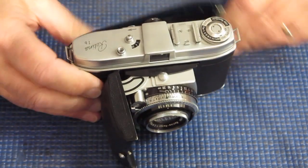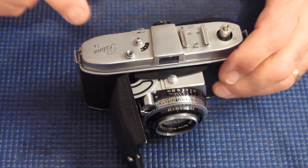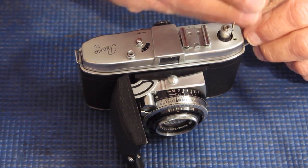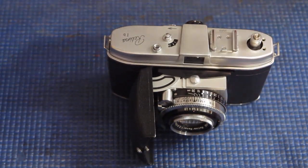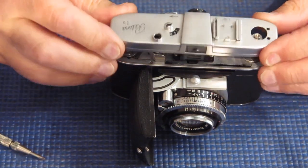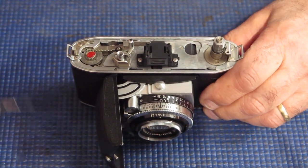The whole front of the camera can't fold because this piece of metal is loose inside, and it's loose because some bright spark lifted the top off the camera, tipped the camera upside down, allowing the shutter release shaft to fall out. I can see these two screws are loose and slightly scarred from someone using a bad screwdriver — one that doesn't fit the screw head particularly well. So I can tell someone had the top off the camera.